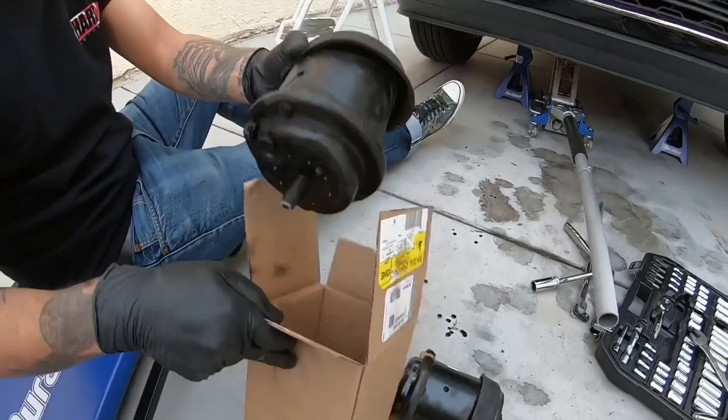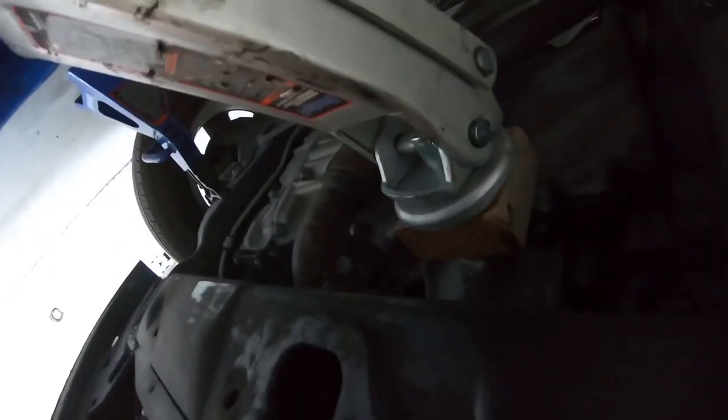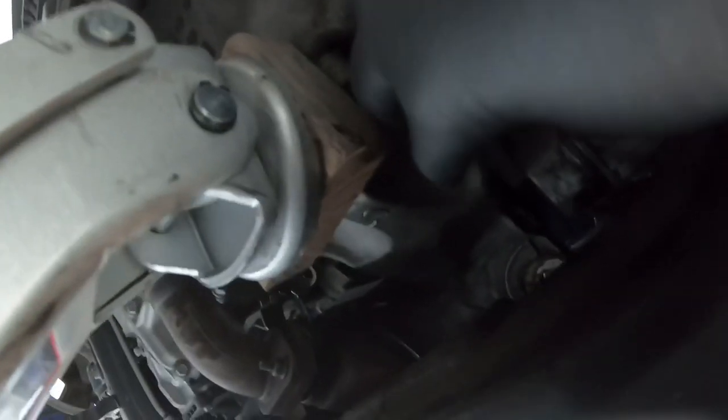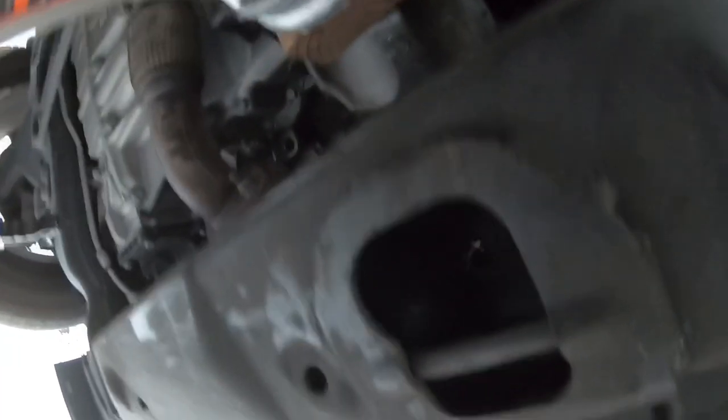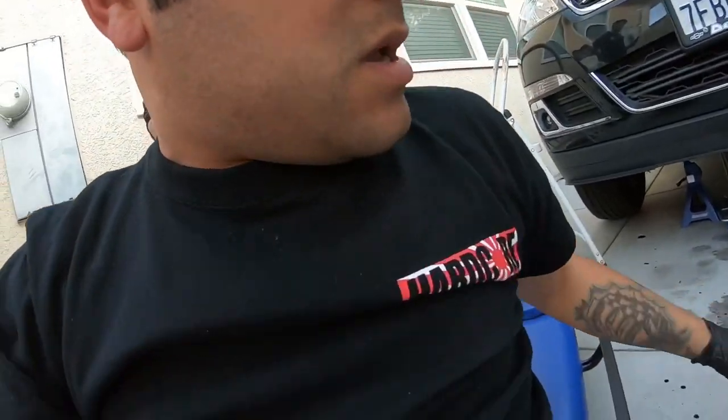Now I've got to wiggle this back in. I took this one out - there's an engine brace right behind it. Going under the car to show you - I have it jacked up using a piece of wood on a bracket. The mount goes in this big gaping hole and you have to work it out, then turn it slightly to pull it through the gap. So now I have to work the new mount in from the side, then get the top stem through that hole and the bottom through the other hole, jack it down and tighten it.